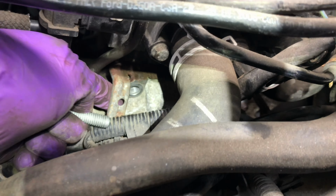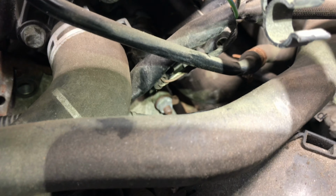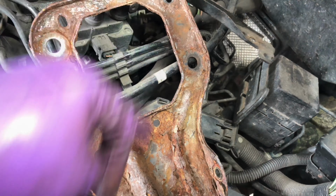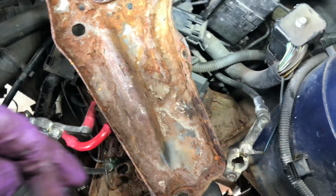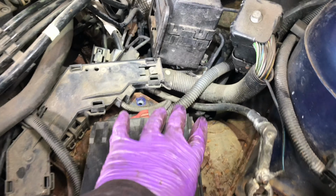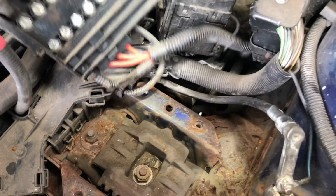Then we've got to get the other one. It's attached to this bracket, so I think you can see it just along there. I'll tell you how I got in with that. I've removed this tray. It lies underneath the battery and it's held in with 1, 2, 3 10mm bolts. That's the one that goes into the wing in there. So with removing this tray, I'll show you this. I think what we can now do is just release this, is it 19, 18? Let me see.